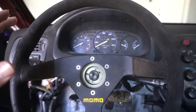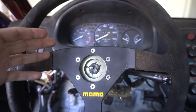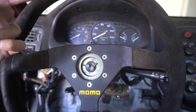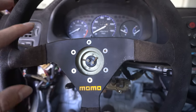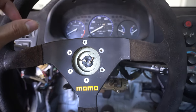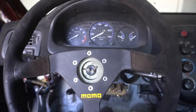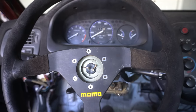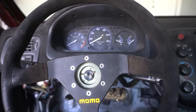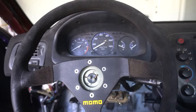So I spoke too soon — the idle did start surging again, but it didn't dip. Before it would go from 2k to 1k, now it just surges all the way to 2k. So now I'm gonna go set the idle screw on the throttle body and hopefully we can drop it down. I mean before it was dipping and now it's just surging, so I don't know if we're getting somewhere.